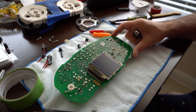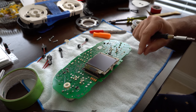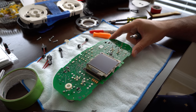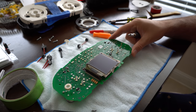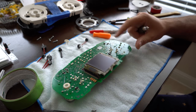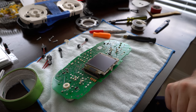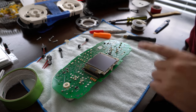I'm actually going to put the screws in to hold it. So it's always interesting to see this kind of stuff with parts bin sharing of parts on cars. It's not made by BMW - it's made by Siemens or VDO, but BMW submitted their plans to them whenever they were coming up with the E90, saying we're gonna need a variable RPM gauge. So rather than just make a special board for the 80,000 or so M3s that will get made, it's cheaper to just make one cluster that would go on every E90 with the provisions there. It's pretty interesting that that's there, waiting there, even though that functionality is not going to be used on the car.